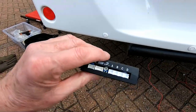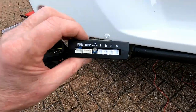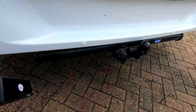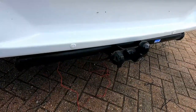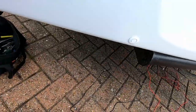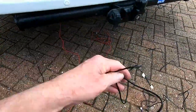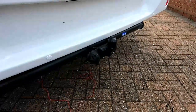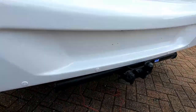On the control box we've got an adjustment - plus and minus. I set it to plus, but that was too much - it was picking up the tow bar. So I just turned it off slightly and that seems to have done the job. Walking across the back and towards the vehicle, as well as the bleeper. So the next thing is to cable tie all these wires - I should take it along and up the driver's side, and then fit the sensor indicator unit in the front of the vehicle. I've taken this cover off - three screws - and I've taken the footwell off. I found a grommet here which goes through to the other side underneath the vehicle, then this will join the control box a bit further down when I get it all tied in. I'm going to put the footwell back and hopefully I'll get the rest of it finished today.